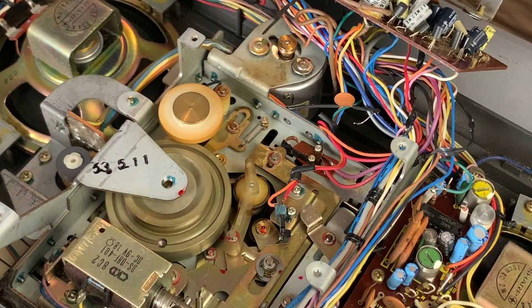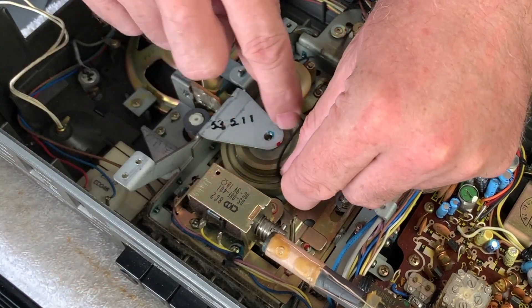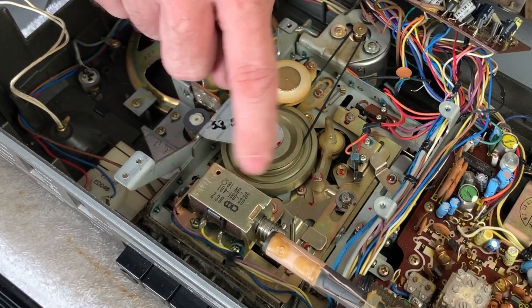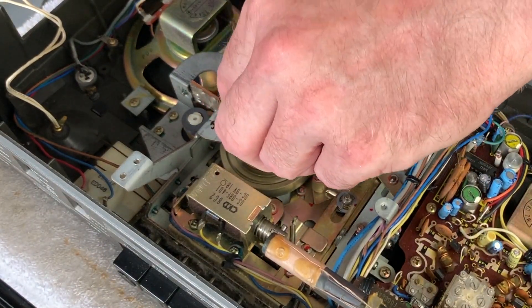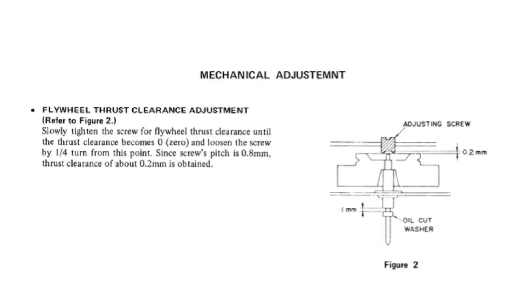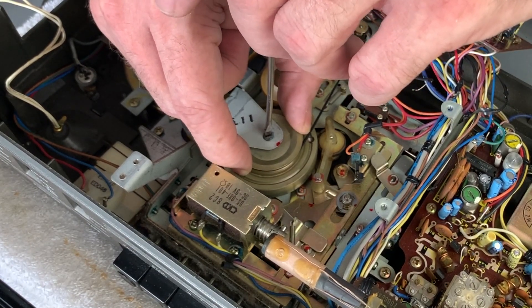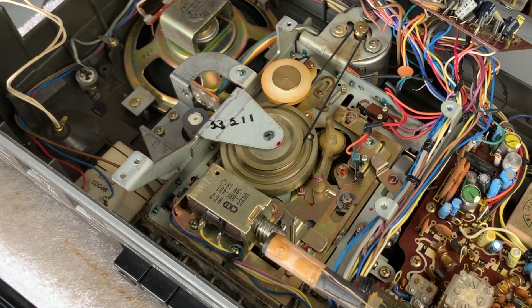We're ready to try the new belt. We take the new belt and thread it underneath like so, letting it settle and getting the twists out of it. Then we refit the grub screw - not all the way down; you want a fraction of a millimetre of free play in that. When you're happy with the feel of it, put a drop of paint or nail polish to lock it back in.